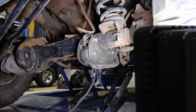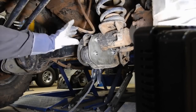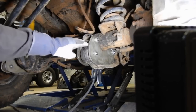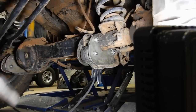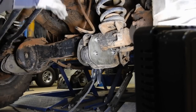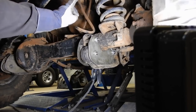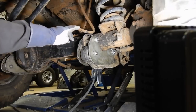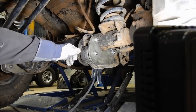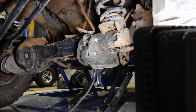I've gone ahead and torqued up all the front radius arm bolts. What I forgot to mention is you can't torque the frame side brackets until the truck is sitting back on the ground — you don't want to tighten it with the axle drooped, because when it goes back to sitting at ride height you'll tear the bushings. So I haven't tightened the frame side yet, only the front ones. You don't have to do any welding on here — I like to do it just as some added insurance. Normally I would MIG weld these, but the TIG welder was already out, so I'm going to hit them with the TIG real quick and then carry on.